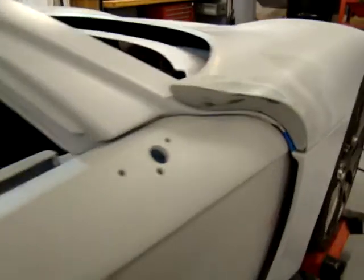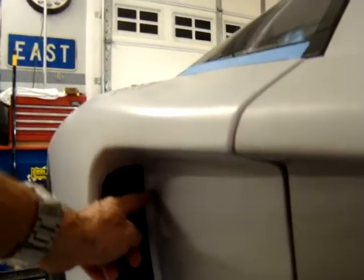Another area that's challenging along the door and this area is these coves have to be reworked and sanded all the way down and through, and you'll have radiuses along here that also need to be reworked, and then of course up underneath there, there's a big mismatch. So the bond line is actually down through here, and you'll end up having to rework and fill in right here where that radius is, so it's a real pain in the neck. You have to wipe these radiuses out with the sandpaper as you go down along there with a sanding block, and then that comes all the way in. I'll show you on the other side, but it comes down to there, and then there's a transition to nothing as it flows down onto the door.